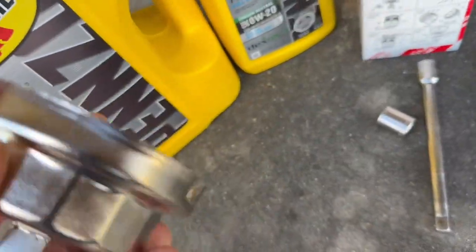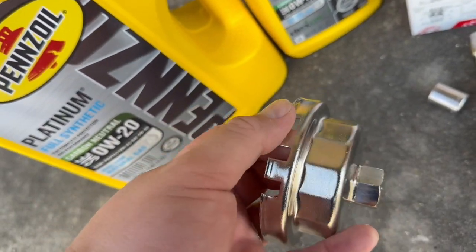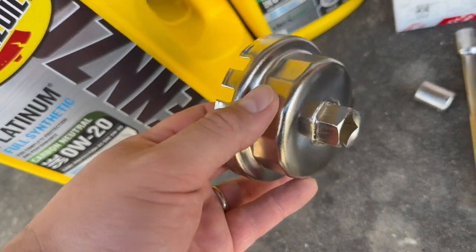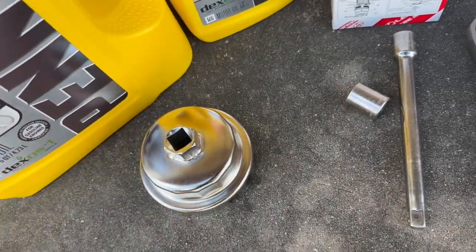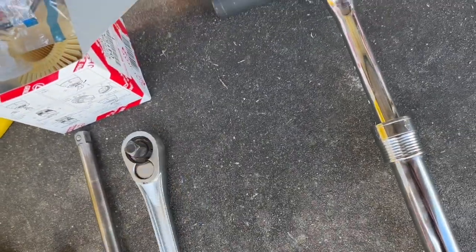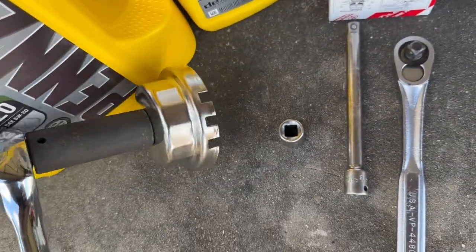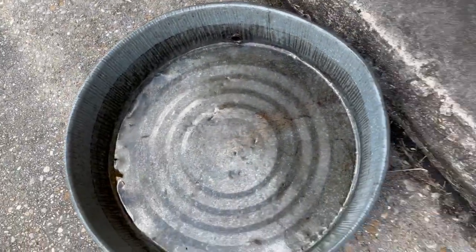You're going to need a special oil filter wrench — this is a 64 millimeter filter wrench. The inside has extra slots on the outside that go up on the canister and help grip it so nothing gets stripped out. It is metal but the canister itself is plastic, so be careful with that. The actual oil plug is going to be a 14 millimeter. You're going to need an extension and a ratchet — this is a 3/8 drive ratchet. I also have a half inch drive ratchet because my oil filter wrench takes a 21 millimeter socket. You're also going to need a drain pan.